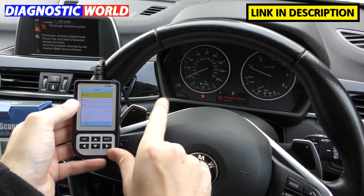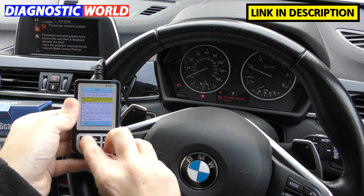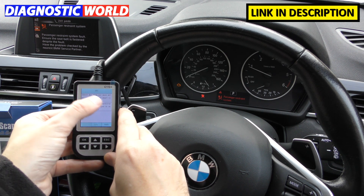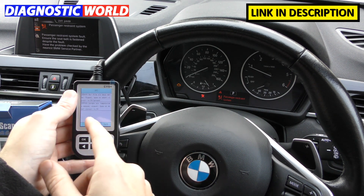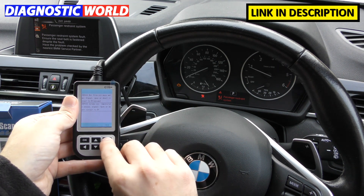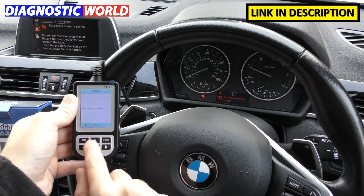What information does it give when you get a fault code? For the check engine light, going into Driver, then Diesel and Motor Electronics, then Read Trouble Code, it gives us two faults — a unique code and a description. It's telling us the hot film air mass flow has a problem with airflow — we diagnosed it as a mass airflow sensor fault. We fitted a new sensor but still had the check engine light, so we go to Erase Trouble Code — and the check engine light is gone. Fault code erased.